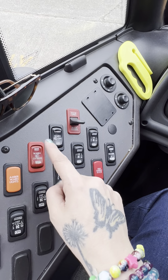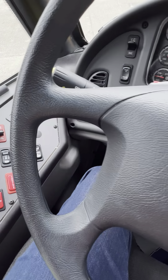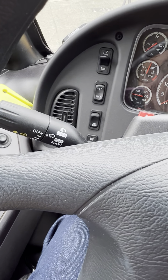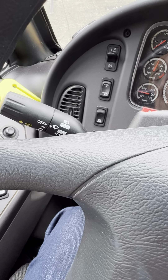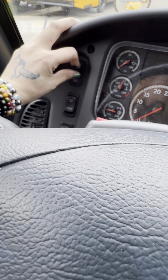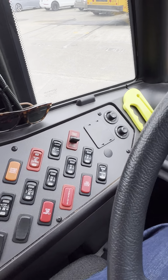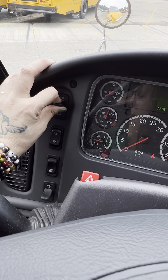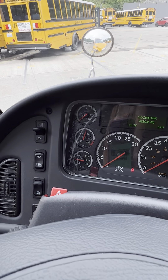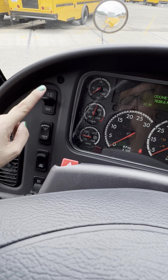I do three sequences in my head. The first: left turn signal, right turn signal, and four-way hazards — same front and back. Second: eight-way ambers and eight-way reds — same front and back. Third: headlights/taillights and ID markers are the same front and back. The two differences between front and rear: in the front it's called headlights, in the rear they're called taillights — think about a tail coming out of a butt. And on the front you do high beams, while on the rear you do your service brake — your brake lights.